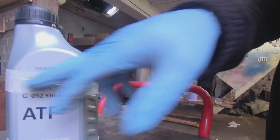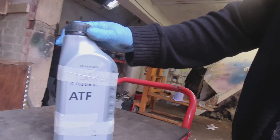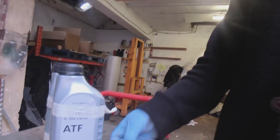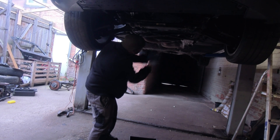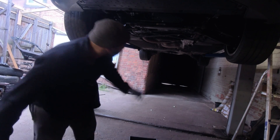I've come back from my drive now. I've got my device ready — this end goes in there so I can get as much gravity as possible. Just want to remind you guys: make sure you get the correct ATF fluid. My gearbox takes ATF, and it also goes gravity-fed under CVT. Make sure you get the correct part number because if you put in the wrong fluid in these Audi gearboxes it messes the whole gearbox up. When I take this out I fully expect a little bit of oil to come out.